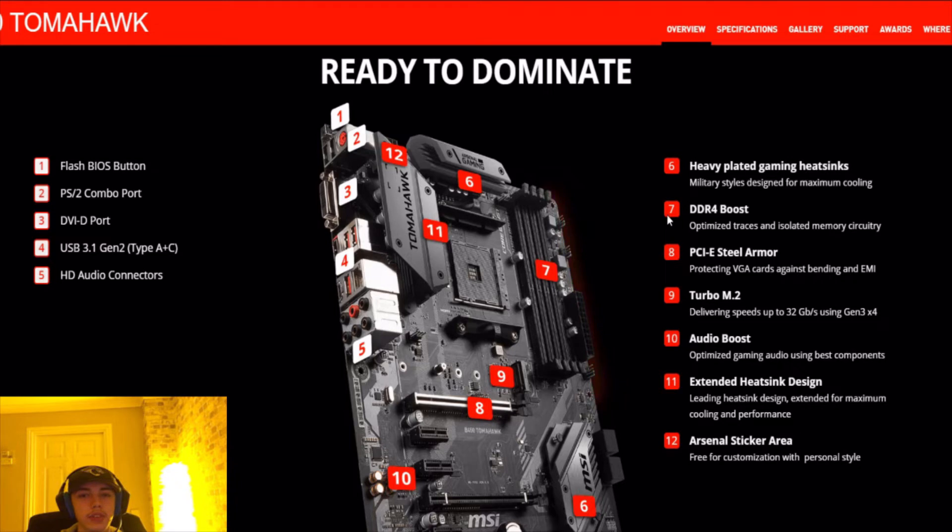The main difference now: if you're getting a Tomahawk, I'd say get the Tomahawk Max, which is more reliably safe for first builds — you don't have to do a BIOS update and it's safe. If you get a non-Max version it can cause issues with the BIOS update. So if you don't want to deal with that, the Tomahawk Max won't need a BIOS update and can run third-gen Ryzen CPUs straight out of the box. The downside is it won't be as fast and won't support upcoming new CPUs.